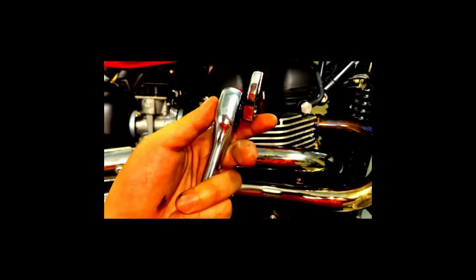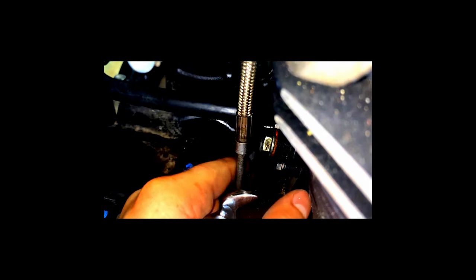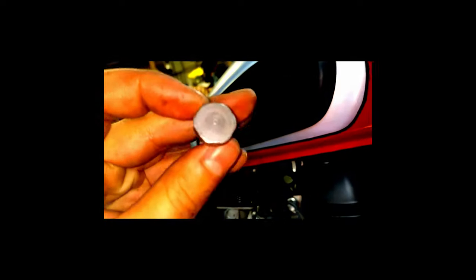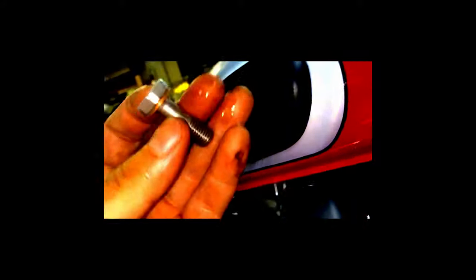I just want to show you something. I had to use this contraption to get in there to loosen this nut. Now I can turn it because you can see someone had previously done something in here — I'm not sure what — and rounded the sucker off. So because of that I couldn't get the correct size on it. Just a socket over it didn't work. Now finally with that crow's foot this thing's coming out. Someone really did a number on that one. Now we can put the other one on and have a better time.